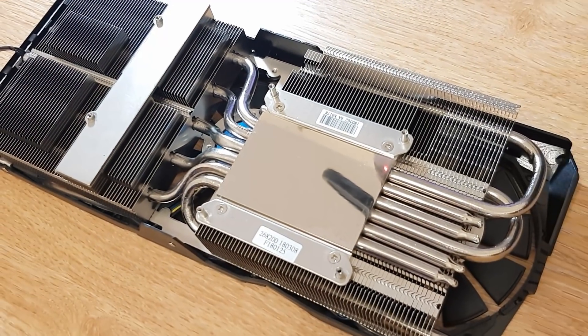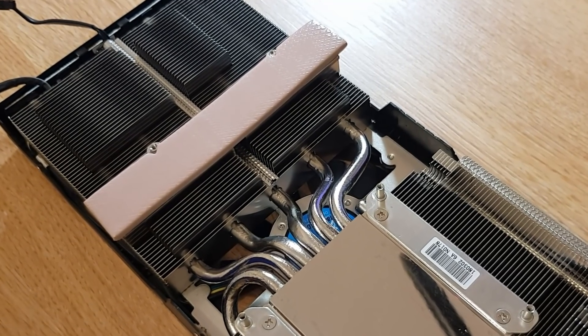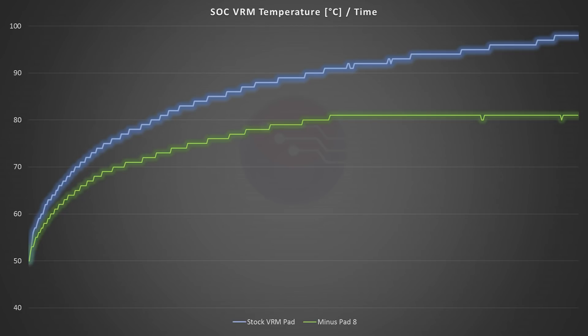But the thermal paste application was never really in question on the Strix Vega 64, and it turned out to just be a cherry on top of what was actually a pretty tasty cake, as the difference in VRM temperatures is where we see the most impressive change. The memory VRM at stock was heading well towards 90 degrees C at the end of the stress test, and it was still rising when completed. With the correctly sized thermal pads in place though, the temperature plateaued at 75 degrees, and as you can see by the curve of the graph, it heated up much more slowly, showing that the pad is doing the job it's supposed to. And while a decrease of 13 degrees C is impressive, it's absolutely nothing compared to the SOC VRM. With the stock VRM cooling solution, the card reached a still-climbing 98 degrees C by the end of the test, so I can actually believe the reports of 100-plus degree VRM temperatures reported by some users. With the Minus Pad 8 though, these temperatures dropped by almost 20 degrees and leveled out at 81 degrees C, which is pretty remarkable for a 12 pound pad.